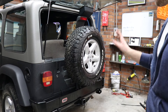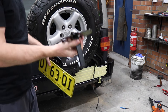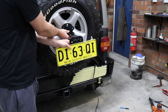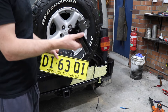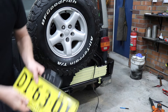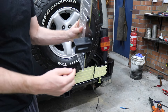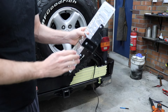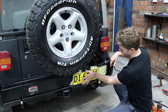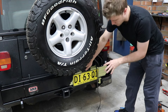The spare tire is mounted now — we just need to work out the number plate. The original mounting bracket is a two-piece design where one piece goes behind the tire and you have to take the center cap out as well. I don't want to do that because I want a wheel bag eventually, so I'm not going to use it — and this bracket weighs 500 grams, so that's one less thing on the car. Instead I'm going to use the original bracket we have, cut off the back piece, repaint it, drill some more holes, and mount it down here — with the light and number plate in a perfect little spot.